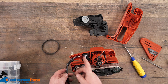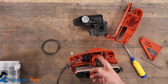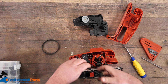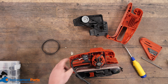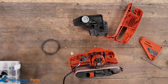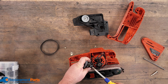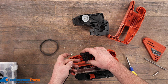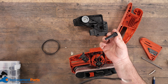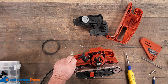A lot of the old tools, this plastic was molded on; the newer tools it isn't, it just slides on. So literally, I could even reuse the cord — cut it here, slide that cover back down to the new spot, re-strip it, add it into the switch. For the switch, in this case we actually have two screws, and we'll open that up. There's the cord off. I can take that rubber grommet out — I can reuse that for the next tool. I could save the screws and the lockdown.